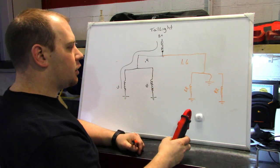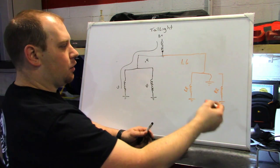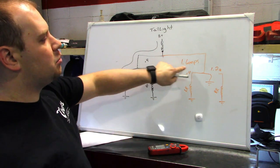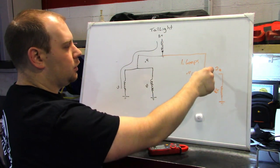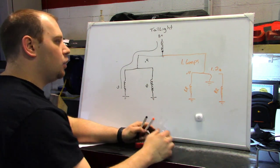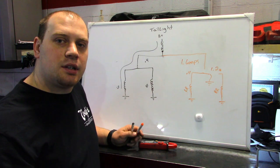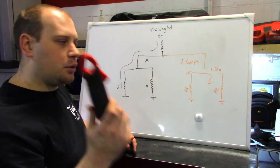To further separate the circuit, I'll use my amp clamp again on each side of the next split. In our hypothetical: if one side is shorted, it might show 1.2 amps while the other shows 0.4 amps, because 1.6 amps is the total of the two legs combined. We can also disconnect a connector to confirm — watch the bulb go dim. So basically I'm going to divide this circuit with the amp clamp and see where it leads. I hope that makes sense.